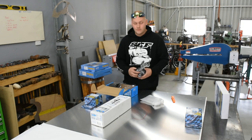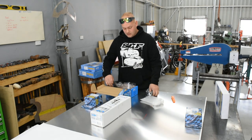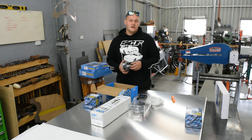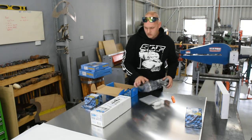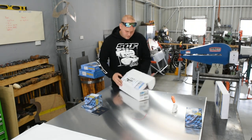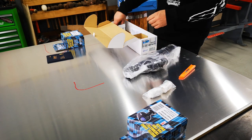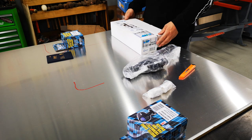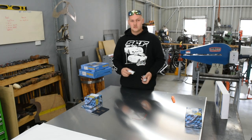This is the EWP 150 pump — it's their largest pump of the range. It's designed to take a standard rubber radiator hose, but it's also internally threaded. We'll be running a dash 16 AN fitting on our radiator lines up to the motor, running all braided line along with that. To get it made up to the motor, we have a big block Chev adapter kit in here — it comes with water pipe, a couple of adapters that bolt onto the heads or front of the motor, and a few other fittings to adapt into our braided line setup.